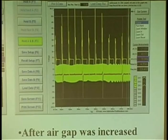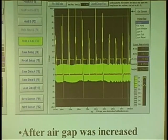I always thought, let's get closer, because close is good, and further away, nothing happens. I never knew that too close is no good. I had no idea. So I think that in some of the newer cars, they clip the AC voltage. Some of the older cars, they couldn't clip it. I guess they didn't think it could happen. But just something to think about: if you're checking an AC signal, too much is no good.